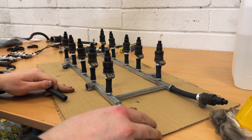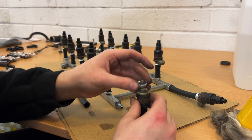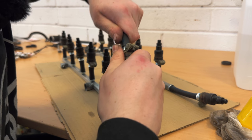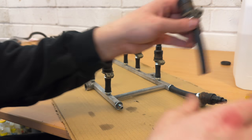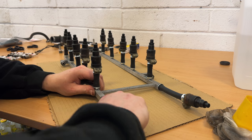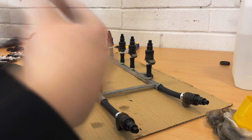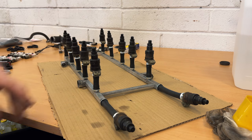Then you put on the other barb - your other ferrule - dip the hose back in the IPA, making sure you know which way around it's going. On the front two it goes forward with the connector. Give it a good shove down, give it a pull - that's not going anywhere. Pretty much that simple. And then you've got all these extra bits to put on. I need to put my final injector on. This one needs to go here facing forward. Ferrule over the top, dip it in IPA, stick it right in there, give it a pull - ain't going anywhere. Put your ferrule on the end, dip in the IPA, ensure this one's going to face the right way - forward, straight on, over the barbs - tightly as possible. Not going anywhere.